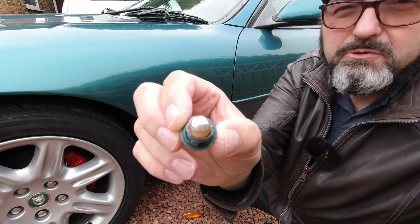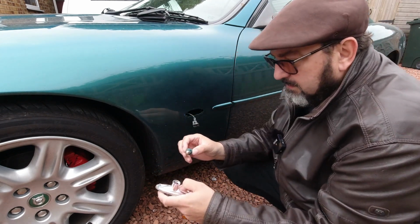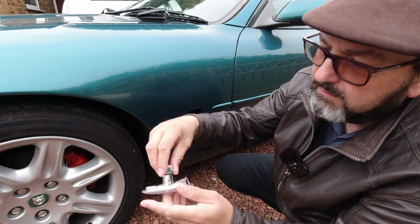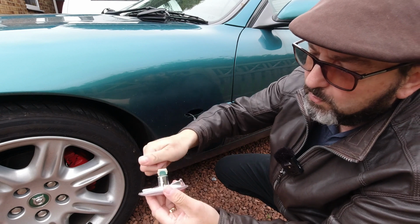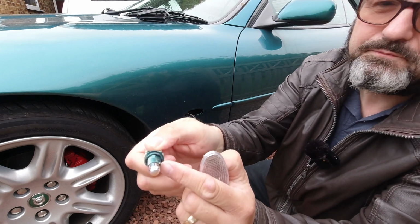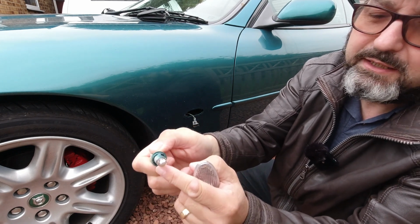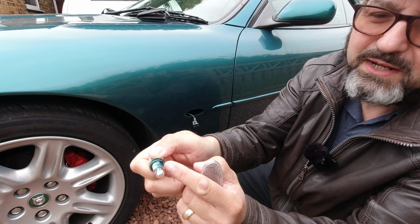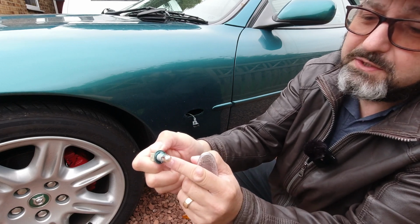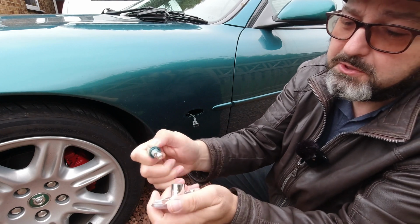So with the chrome lamp installed, again, you just pop it in, push, and with a quarter turn. So a little note, there's a rubber ring around here, stops these filling up with water. It's just a plain O-ring. If you've lost it or if it's degraded and fell off, then a 1 centimetre bore sized O-ring will do the job just nicely.